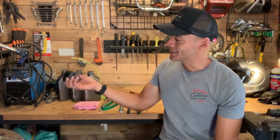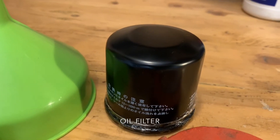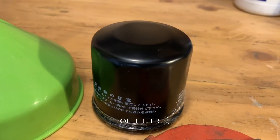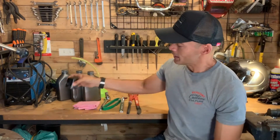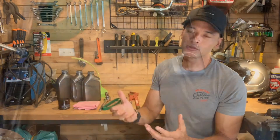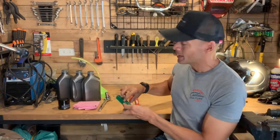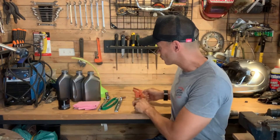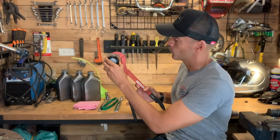It's really simple. Today I'm going to be changing the oil on my motorcycle, which is a Yamaha XSR 900. You're going to need a fresh oil filter. You don't need to change your oil filter every oil change — it's recommended that you change it every other oil change. I'm going to be changing my filter today. You're also going to need some kind of tool to remove the filter. I'm going to be using a strap wrench. You can improvise — use any tool, some sort of pipe clamp, to get a good grip on your old oil filter.